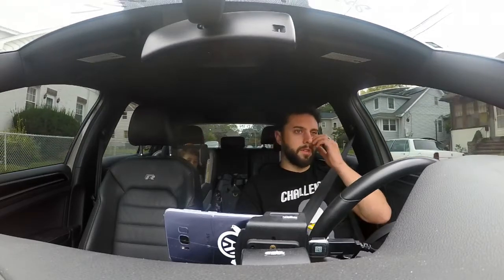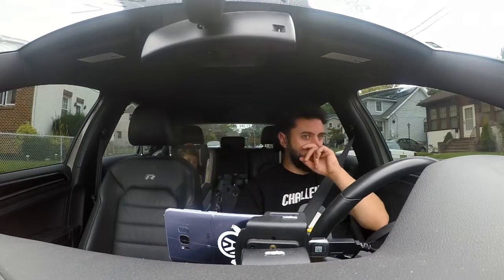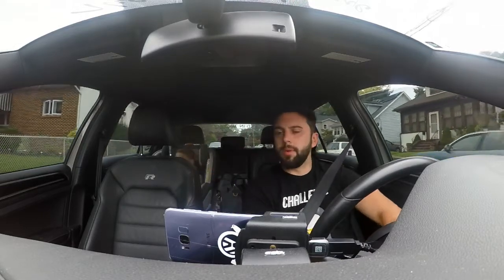So there's two ways of looking at a JB4 as far as the user settings page goes. You're going to see some guys with numbers from 1 to 5, and then you'll see other guys with actual boost targets. What I use is actual boost targets in my tunes, so you'll see 22 pounds, you'll see 23 pounds. Whereas the guys that have 1 to 5, they're not running 1 to 5 pounds of boost. They're running 1 to 5 pounds on top of the stock boost.